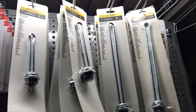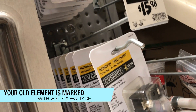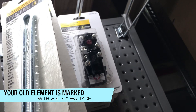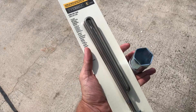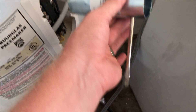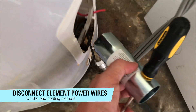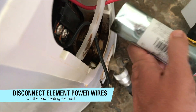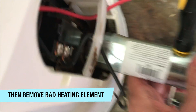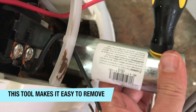For the most part, the parts are relatively universal and fit a lot of different brands. The big thing to pay attention to is the wattage — you can even replace thermostats. This is the heating element, and this is the tool that helps remove it. Simply use a flathead screwdriver to go around it, then it fits right over the top of the heating element and we're gonna loosen it up.